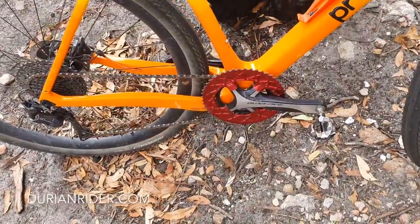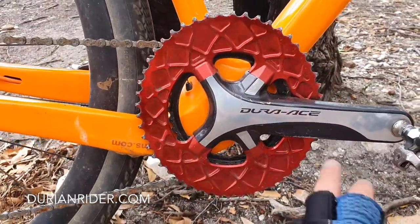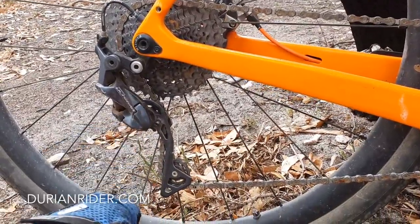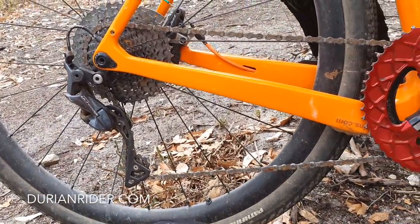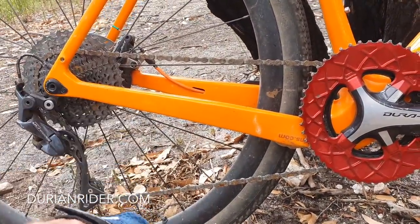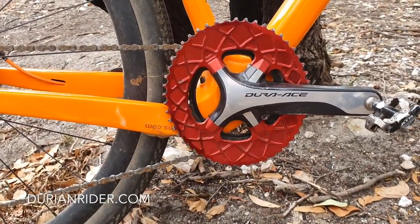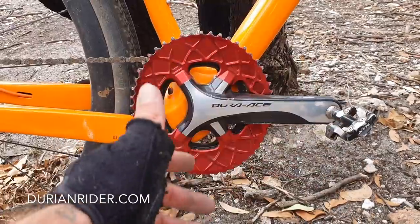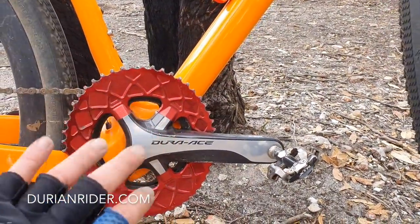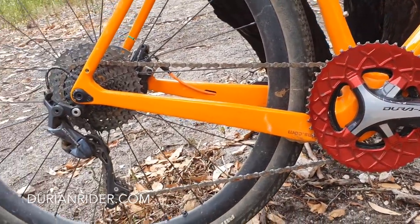I've got the Absolute Black chainring on there with a Powermeter for data. The gearing today — 50/34 Absolute Black with a 40 at the back, it's the XDR cassette, works with the GX derailleur. I felt good but ran the gear a bit hard — cadence was a bit low. I'll put the 46/30 on these cranks. These are just the test cranks we've been using with the SL7, the Morita, and the Pragma — testing, trying to keep all the variables the same: same pedals, same power meter, calibrated.